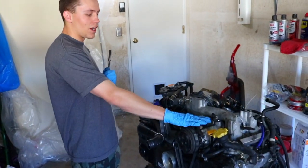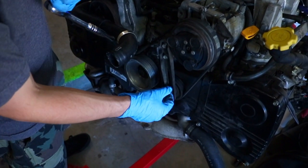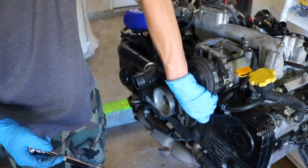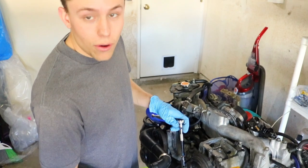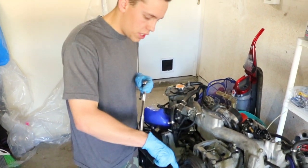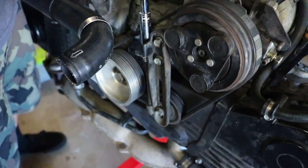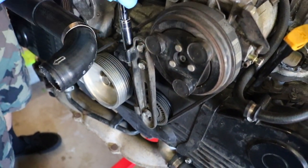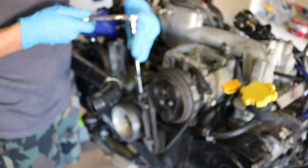The next step, we're going to be taking off this AC compressor. We have to get off this belt of course. So you just want to loosen up this pulley — you don't want to take this bolt all the way off, you just want it a little loose so you can loosen tension on it and get that belt off. Once you get this a little loosened up, you can come up to this bolt up here. This is that long bolt that runs down, and you start backing this out, and it will actually bring the pulley up towards you. You can see that pulley coming towards me, and that's taking tension off of it. Once you get to a point where you feel like it's loose enough, then you can take it off.